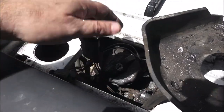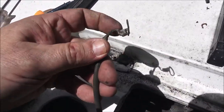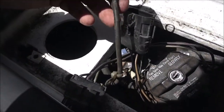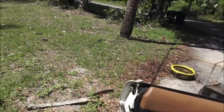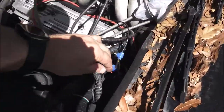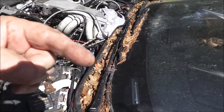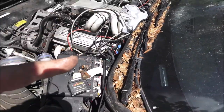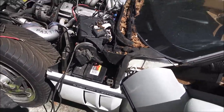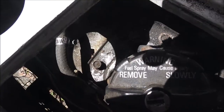The pump is not running, so we're going to have to pull this pump out. I found another wire here that looks like a big ground wire. This one wire goes down, wraps around the suspension, and comes up into an aftermarket relay. There's a plug down underneath here with wires that go back to the fuel pump for the fuel gauge and the pump - and it was laying on the header. Fortunately it did not burn through. Thanks Monk, sorry for the wind.